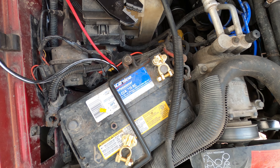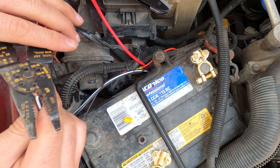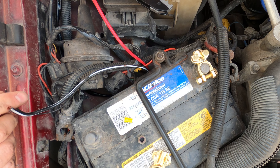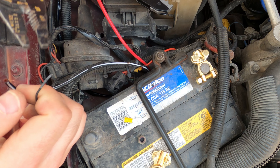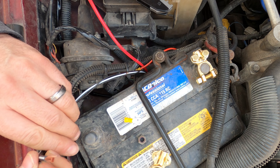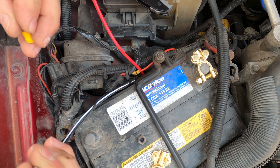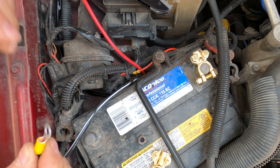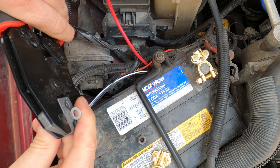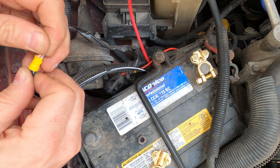On the negative side there are two wires for this compressor — one is for the power and the other one is for the controls. The reason there's two is if you have a 24-volt system they use the same harness but wired up a little differently. On this one of course it's 12 volts, so the negatives are both connected to the same connection point in the system. I like wrapping it around the other wire just so it doesn't get caught on anything else.